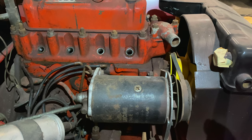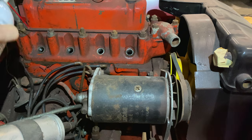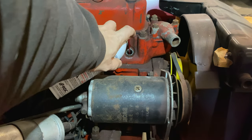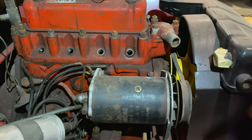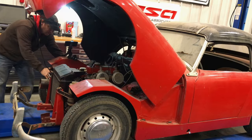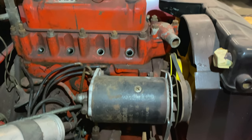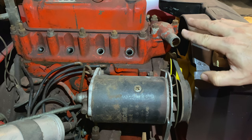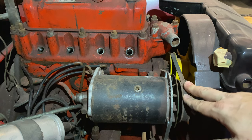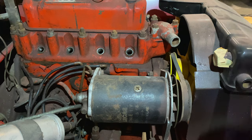Okay, here's the moment I've been waiting for — two or three months since I made the other video. Before I try to see if it'll break free, I'm going to take a little bit of penetrating oil and spray it down into the cylinders. I have the car in fourth gear right now, so if I push the car back and forth it should try to turn the engine. The generator was moving a little bit, which means the engine is moving a little bit. It is locked up enough that it's not going to make one full rotation, but this is a good sign. I'm just going to keep working it and hope that it keeps moving a little bit more every time until I've made an entire rotation.